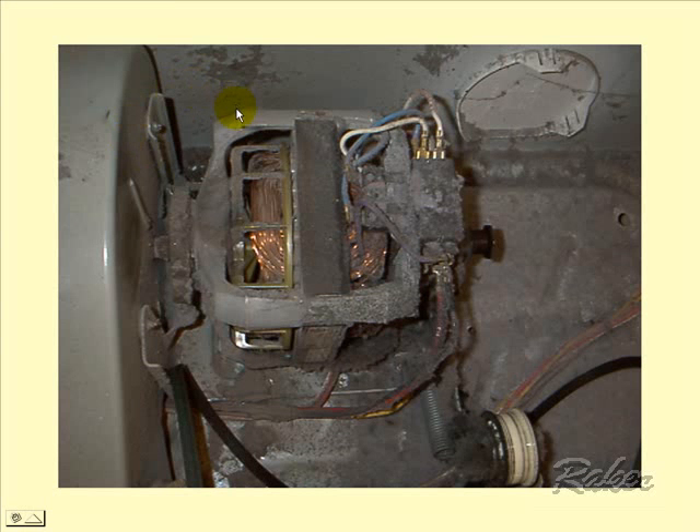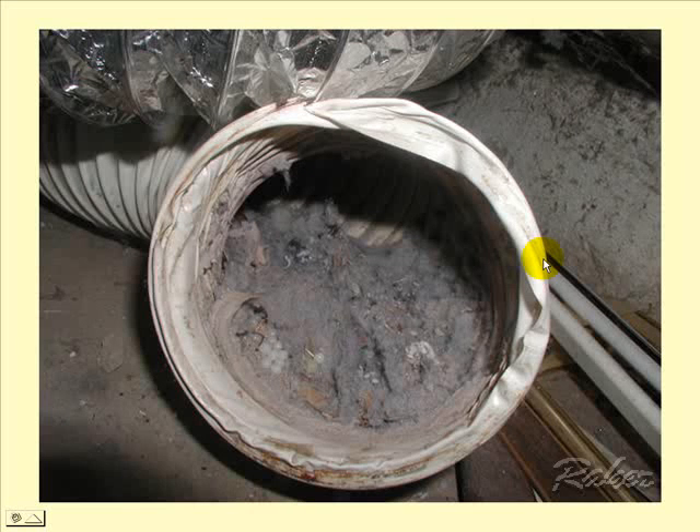Here's a drive motor sample with the blower at this end and the pulley at this end, along with the tensioning device. This is pretty much what they look like — filthy, dirty, full of lint and fuzz. They may come out in slightly different ways, but the theory is all the same. In my service manual on dryers, we talk about airflow and the general concepts of how the air comes in and out of the dryer basket and flips the clothes.